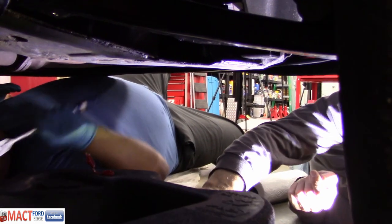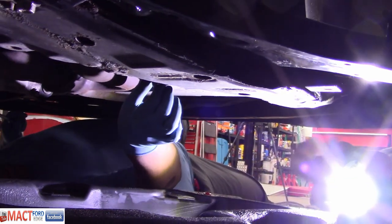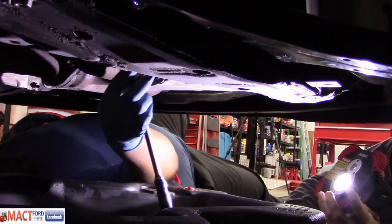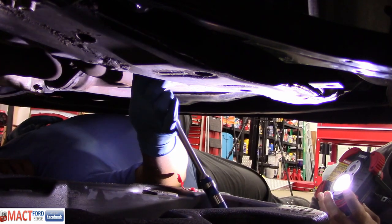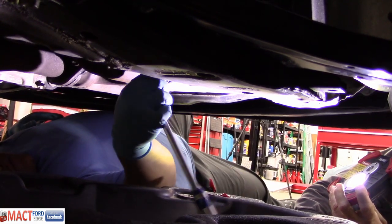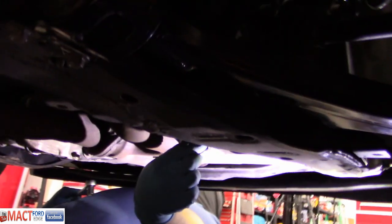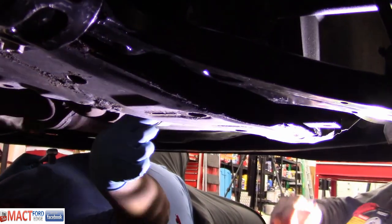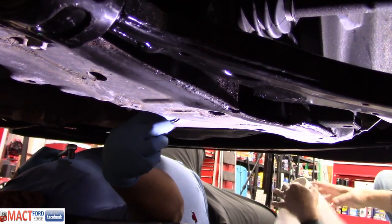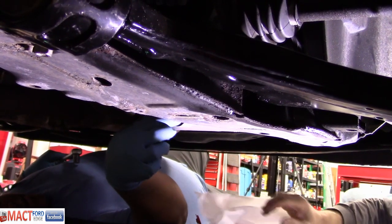Okay, now we can start getting the pan under here. All right. Can we change the lighting? No, you'll have to get the wrench on it again for a bit. I will. Yeah, it's too hard yet. You've got to get it so you can loosen it with your fingers. Oh, okay. I never do that. I can't believe I'm changing my own oil. That feels like it's loose now, already. Yeah, I'll take the wrench. It's loose. Okay, yeah. Just let it drop in the pan, okay? Just drop the bolt in the pan? Unscrew it and let it drop in the pan. And don't leave your hand over the pan, because it's going to be full of oil. Your gloves will be covered with oil.